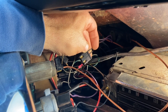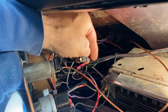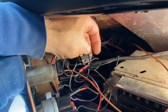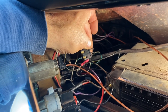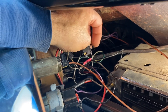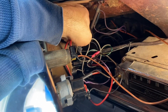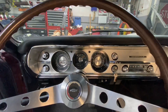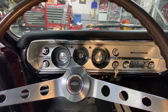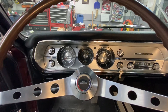So if you have one in your car and it seems to be working backwards, you could just unplug it and flip it the other way. This one came off with the black and white on top, and that's where I'm going to put it back. I have no idea if it works — I won't know until an engine gets put in this car, since I've never seen it with one. I did check the continuity of the gauge and it had continuity. I found out after putting the dash back in that I could have tested it with a small battery to see if there was any movement.